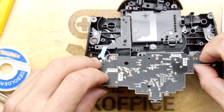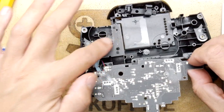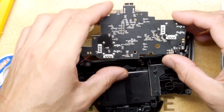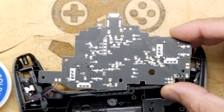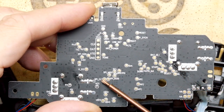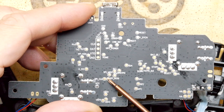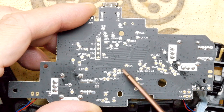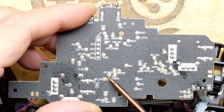There we go - that's the battery PCB. So everything we need is on here. Look how wonderful it is - they've actually completely labeled that up. You've got your SPI clock, your SPI MISO, your SPI MOSI, your SCL - so you've got I²C, SDA here. So you've got your I²C bus here and your SPI bus here. So you could intercept that. You've got what appears to be a JTAG-type interface, your three-volt supply.